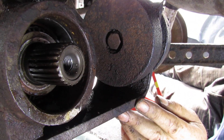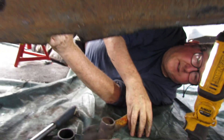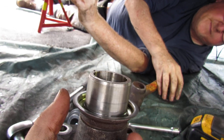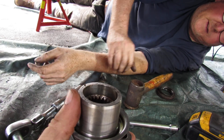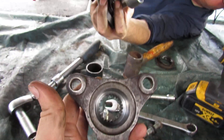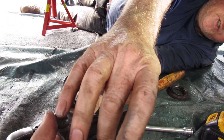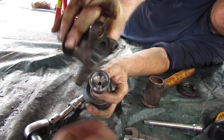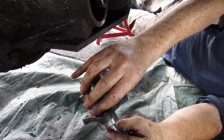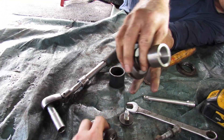So that's the splines there for reference, and this is the flange. We've cleaned all that up now — make sure both parts are cleaned up. You need to use a couple of thousand-grit sandpaper and really clean up the sealing surface. In your hand you can see it's tapered, so it just slides back in and needs tapping in.